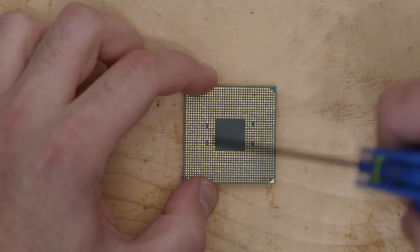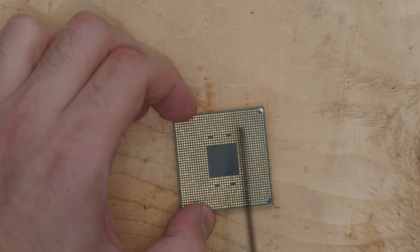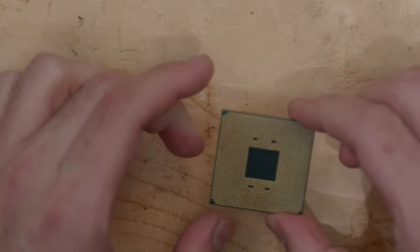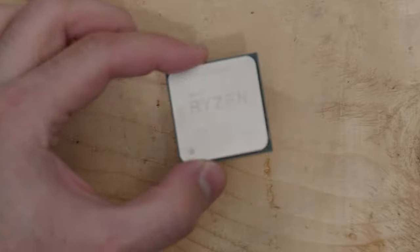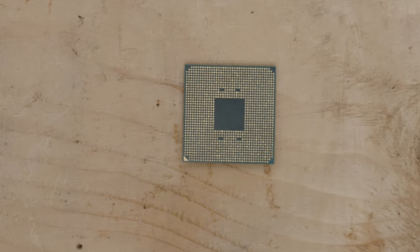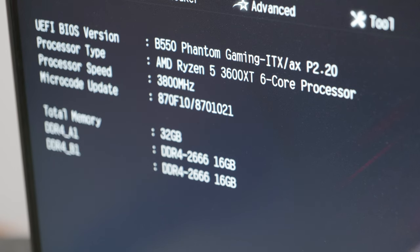At that point I think it's pretty safe to install this once you don't see any changes in moisture in the CPU as you blow the air across it — it looks pretty dry to me right now. I can hit the top too and see how it's just instantly gone. If it's not instantly dry you're still going to want to blow the excess out and then let it sit for a while until you're sure it's dry. Here you can see it's installed in my ITX system and runs perfectly.